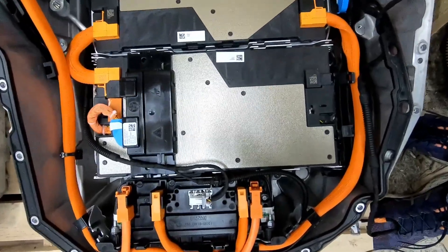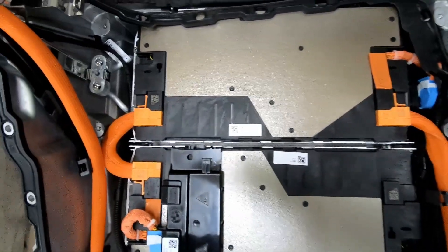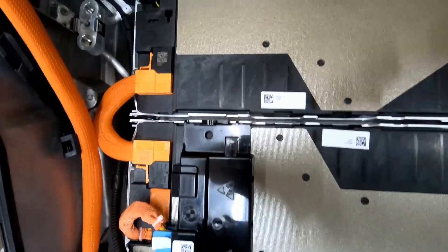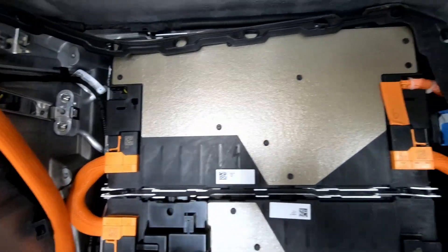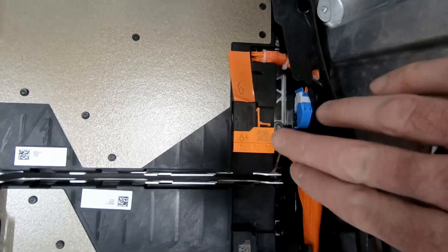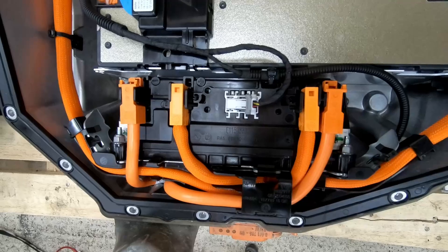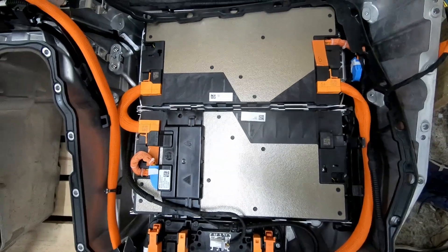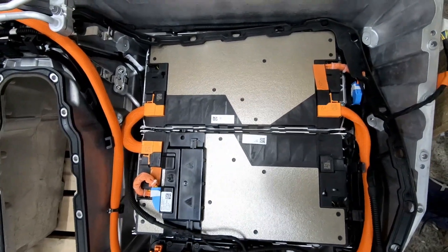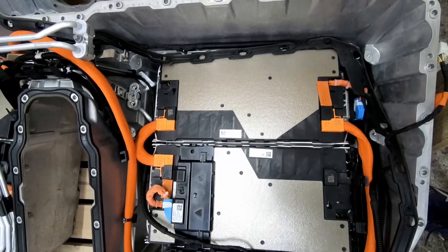Looking at the lower tier, it's really just exactly the same as the upper one. You can see that the polarity, the way they're laid out, is flipped just to make sure that there can be some really short connections between the two closest modules. And as you can see here, you've got the positive from number six making its way out under here to the positive contactor. I'm just going to finish marking off the BMS wires and then we'll take the remaining modules out and look at what's left.